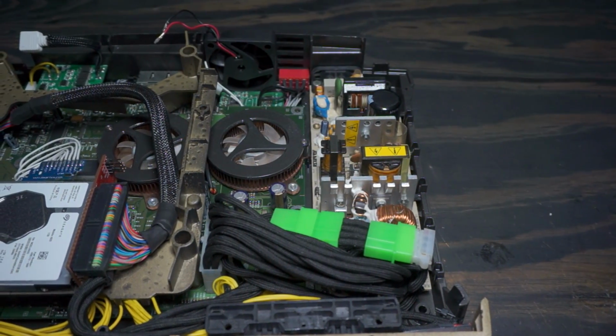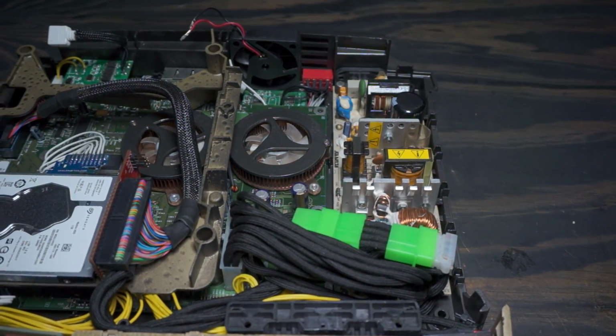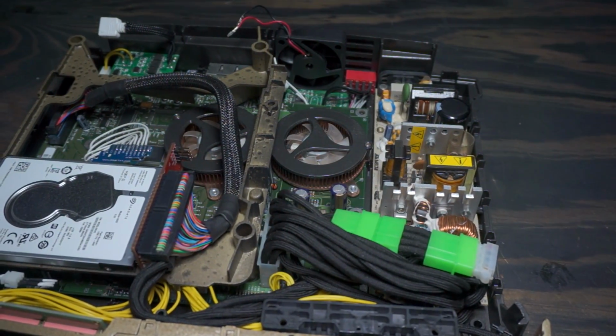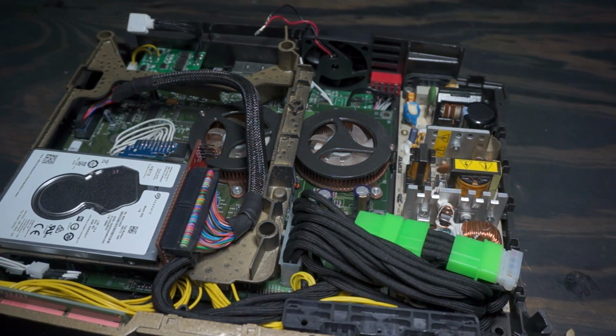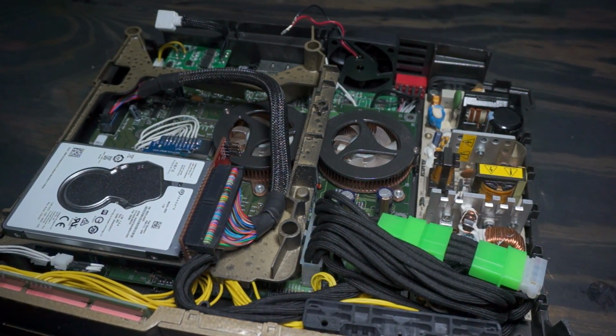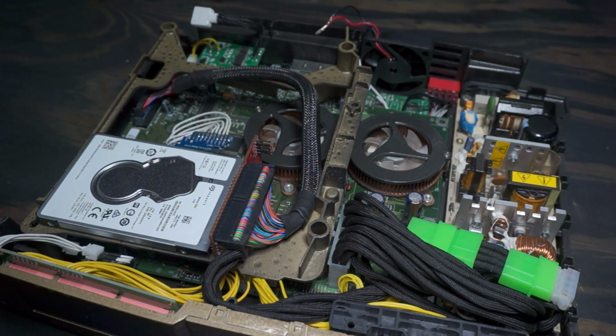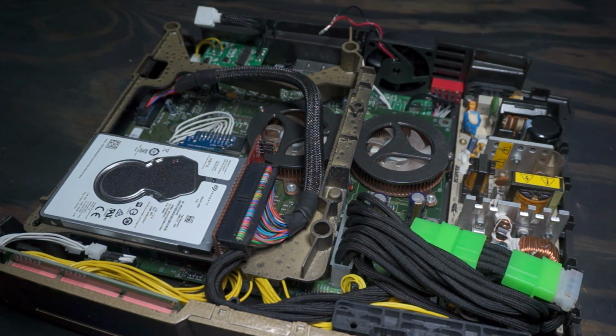The hard drive has moved onto a modified DVD drive tray. I paint matched my Iceberg Pro 4 coolers. I swapped the motherboard from a version 1 to a 1.4 just to simplify the inside by getting rid of the controller port daughter board. My mod chip has moved more towards the center because it just works best there,